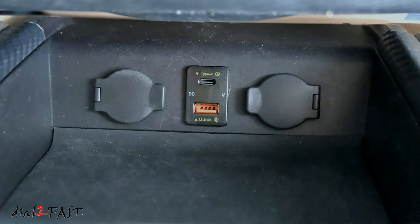The first thing I'll do is remove the panel underneath here. Disconnect the connector to the lights. Next I need to remove the shifter — pull down this collar and there's a metal clip you need to remove. Now you can slide this up. Next remove this panel; there are clips along the side. Before you can remove this, disconnect the two connectors behind the seat warmer.